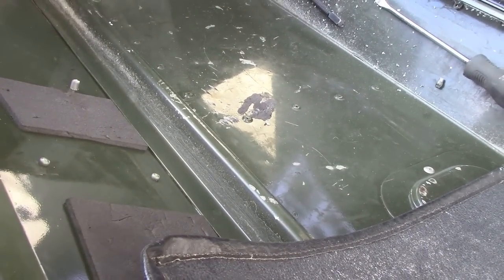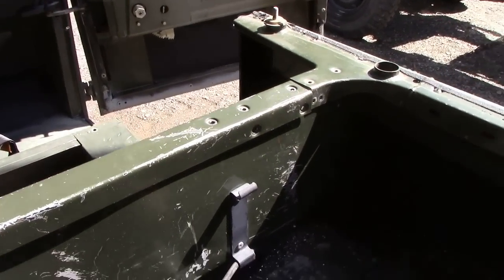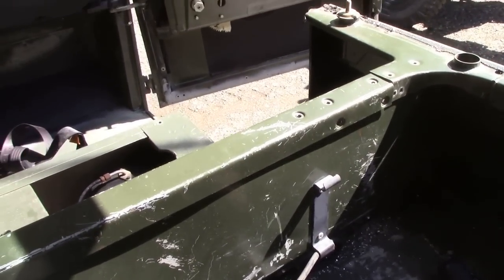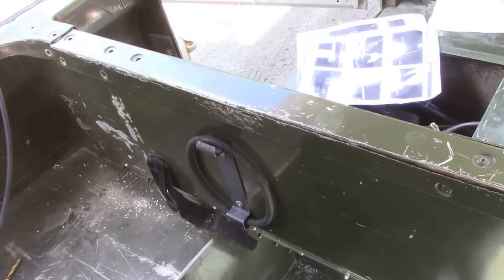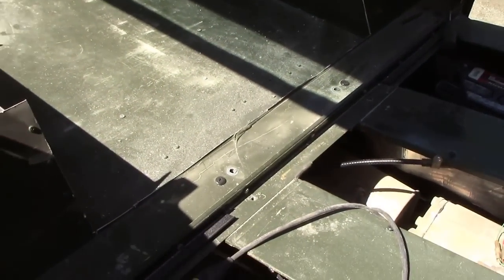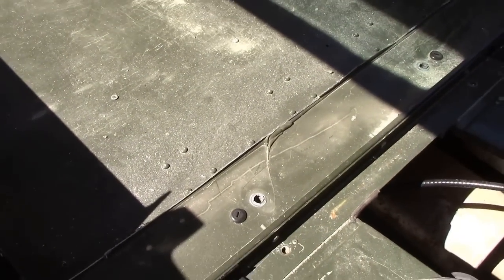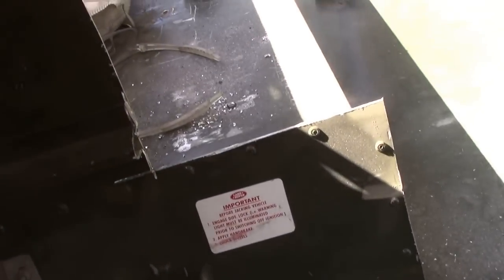You should be able to chop that piece out. Look at that — it's already 20 to 10, not too bad. Look at this — it's already out; there's only that reinforcement bar holding it in. Right, let's get chopping. I'm going to use a very thin disc cutter, which I usually use. I'm not going to use my plasma, which would be really, really easy, but you probably haven't got a plasma, so I'm going to do it with basic tools. Nearly 5 to 10 and it's out — easy. I always wear a dust mask when you're cutting aluminium because it's nasty stuff. I cut this a little bit proud because I want to put a flap wheel across there. The next bit is to get this bit out — that's not too bad to do, it's a bit tricky.